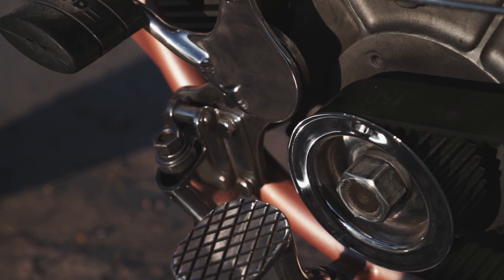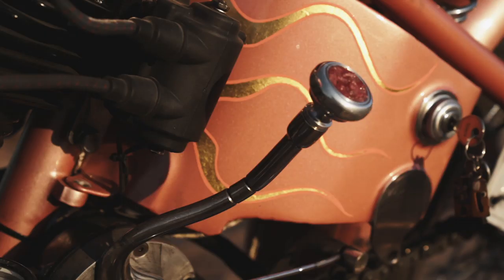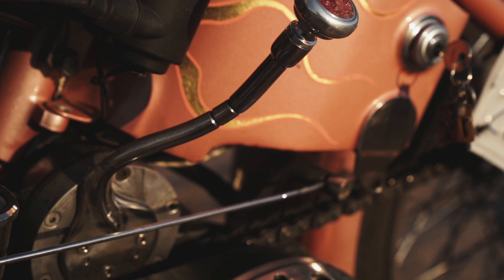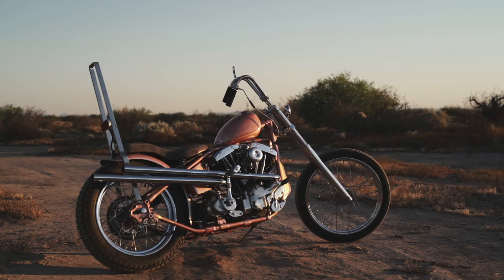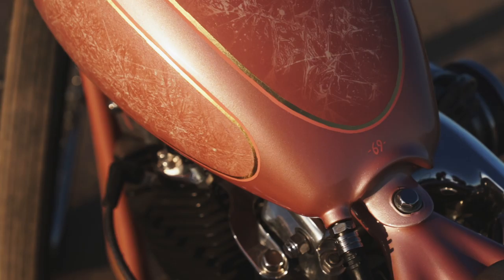I made all the controls on this bike from stainless — it's all been metal finished and polished, everything styled with the same shapes so it all looks the same when you walk around the bike. Everything else was cut up and modified a little bit, even the stock Harley parts I did use — the Hydroglide trees and stock Harley oil bag were all cut up and changed just a little bit before paint and polish.